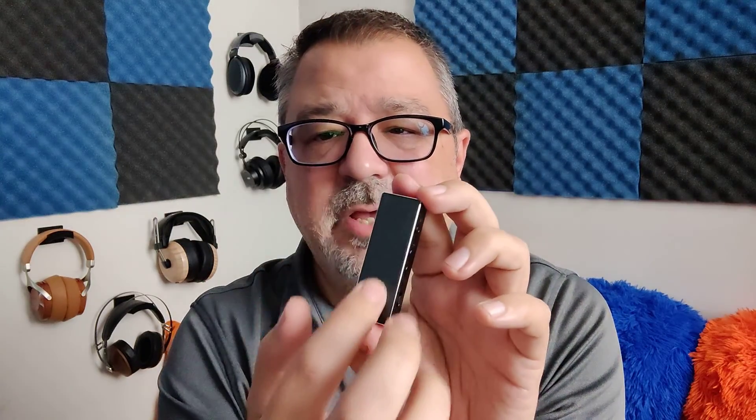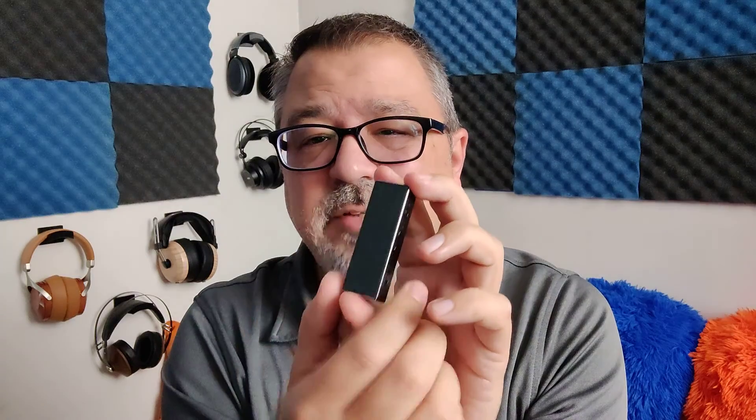You have volume knobs, and if you double-press them, you'll change your gain — indicated by all the LEDs lighting up. If all the LEDs go up, it's on high gain; if only the top ones show, it's on low gain. There's another button up here, which is a multi-function button. Pressing it and tapping cycles through X-Space, X-Bass, and then off, or together. If you press and hold the top button for two seconds, it goes into filter mode, and you can cycle through the various filters using the volume knobs, then confirm by hitting the top button again.